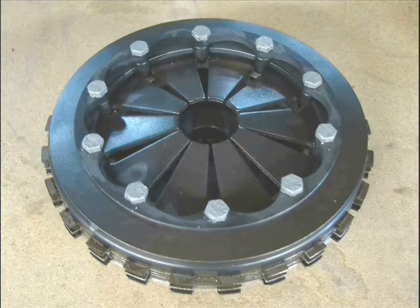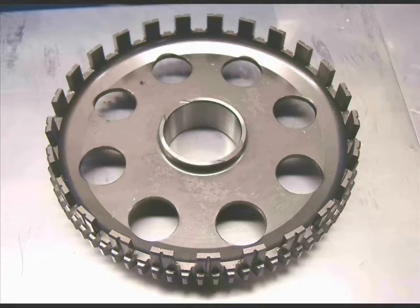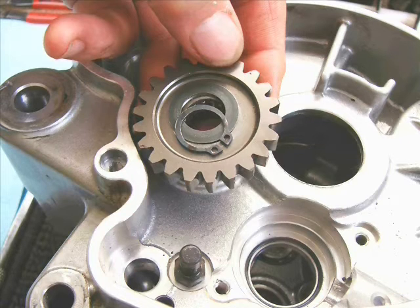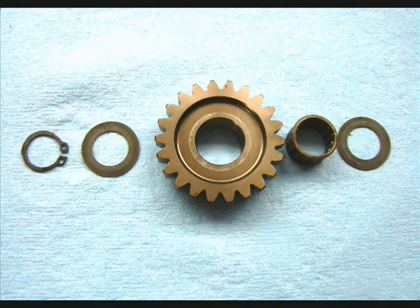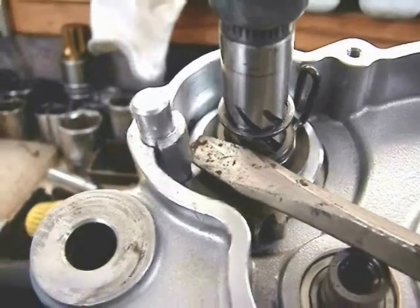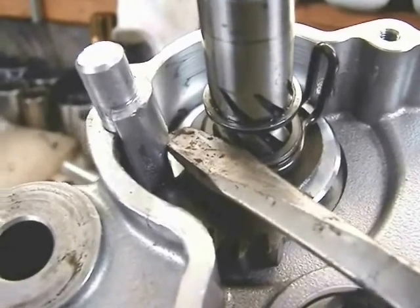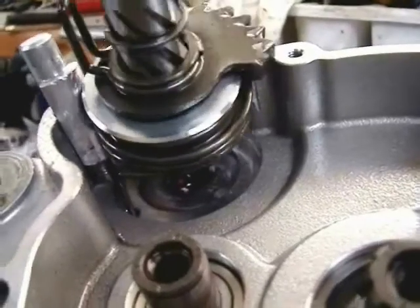Here's what the clutch looks like removed from the engine without the basket. The back side is billet machined. Then we have the basket — front side and back side. The gear on the interior of the back side is part of the kick start gear mechanism — it moves the basket so the basket can turn over the crank. We're going to take off the kick start intermediate gear next, which sits between the basket and the kick start shaft. It has two washers, a clip, and a bearing. Now we're going to take out the little aluminum kick start stop — you have to get under it with a screwdriver and rotate it to draw it up. It's a mild interference fit. You have to raise it to get the shaft out.